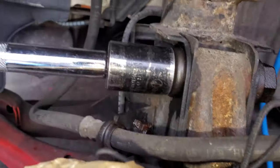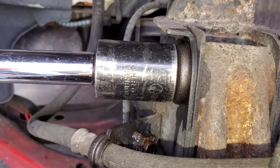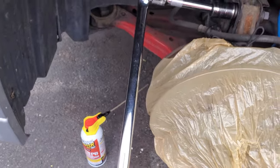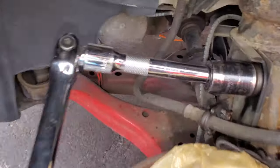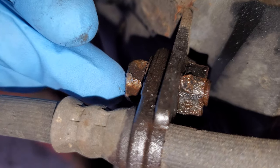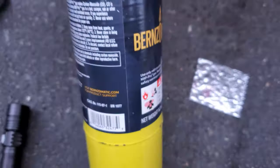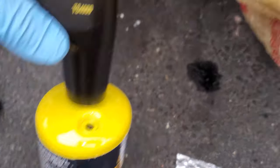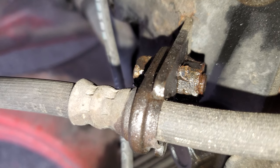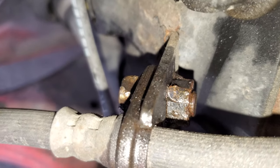Outside tie rod ends, I need to take those off. Already loosened up the right side; now I'm on the left side, the upper bolt of the stock strut. These are 19mm socket, so I got my long breaker bar. This brake line bracket bolt just doesn't want to move. I stripped a little bit of it on top, so I don't want to do that anymore. Normally I would use fire, but since I'm so close to the brake line, I'm hesitant. I sprayed some PB Blaster on it — let me just see if PB Blaster will catch on fire.